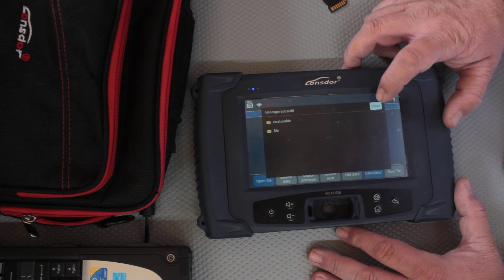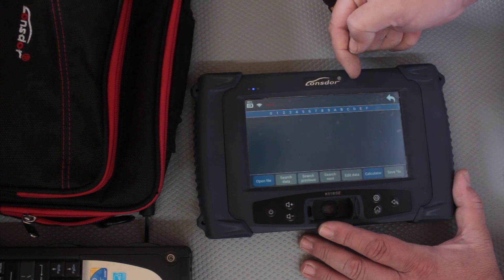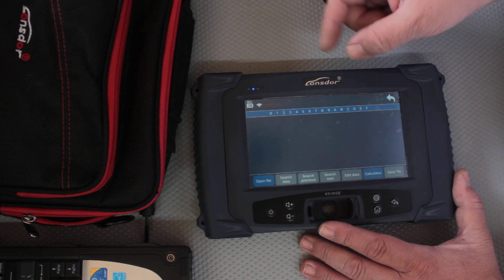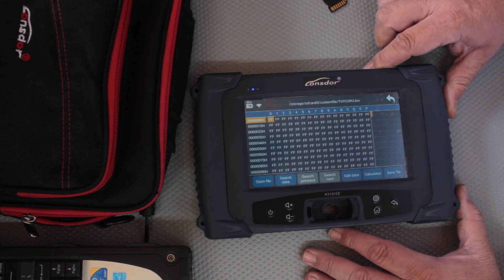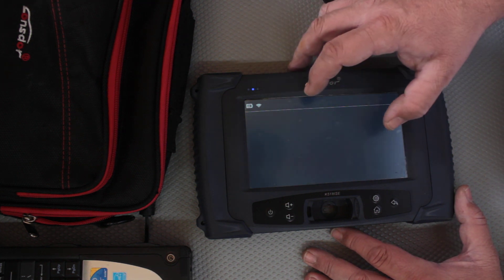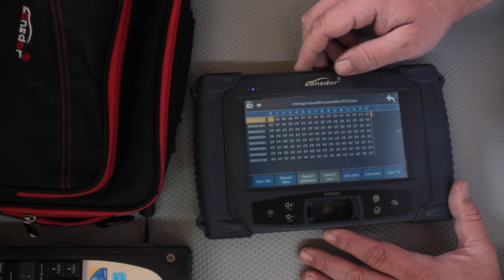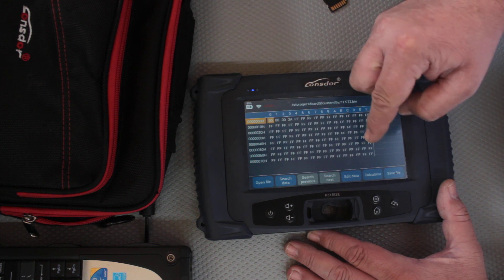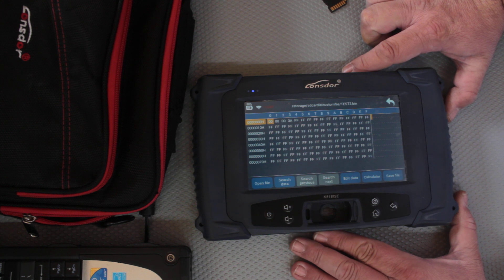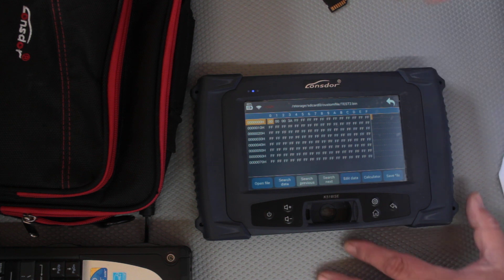So as where I can read the chip from the car's computer and display the text here, unless I'm ready to start editing that on a job — which can be done — you have to be reasonably familiar with it: know where the buffer points are, know where the actual coding is. For example, here's a file — that's not a good example, let's bring up another one. Okay, so there's a file with some coding in it — there's a couple of bytes here, a couple there, bytes all over the place. Very hard to just throw them in and know exactly what you're doing.